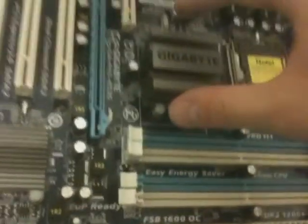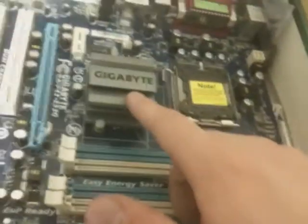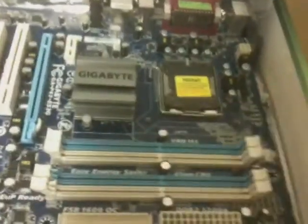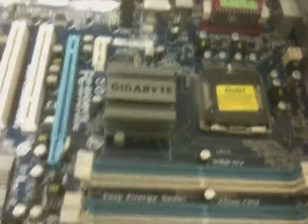I had to take a slight detour. When I was lifting this thing by the heat sink, the thermal grease actually came loose from this chipset heat sink, so I had to take the chipset heat sink off and reflow it with the Arctic Silver, which is going to be a lot better than the crap they put on there in stock.